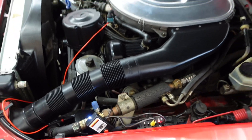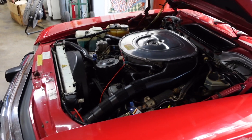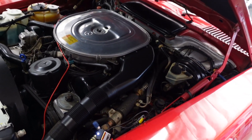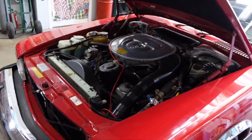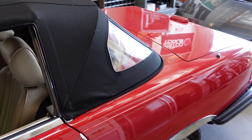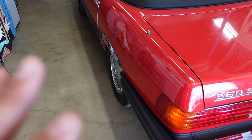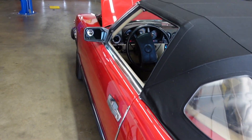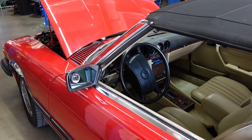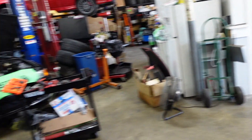This is what I was talking about — to diagnose properly, we get rid of all the past events that may have triggered other faults and get down to what's actually upsetting the vehicle. Code two is the SRS control unit itself. I'm not super surprised — that is a common issue. The SRS computers get corroded over time and fail; it's a well-known problem with these cars of this era. I'll probably pull it out and recondition it, and if I can't succeed I'll fork out for a factory unit, so long as the customer approves.